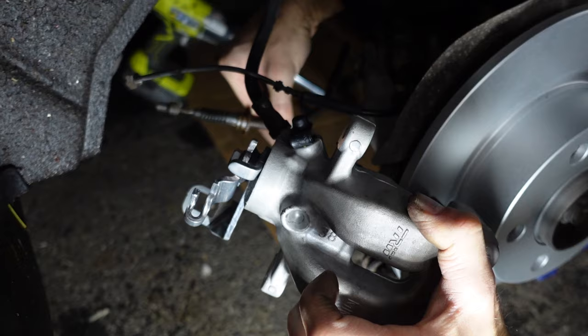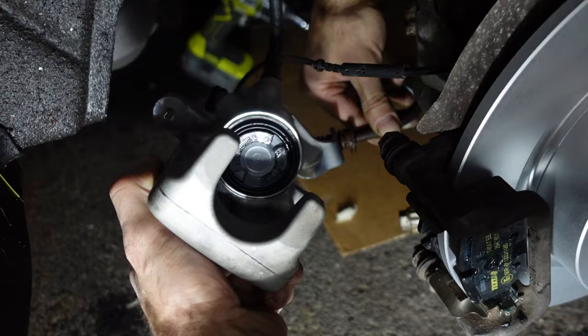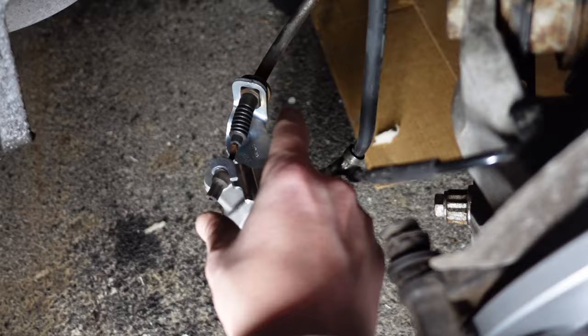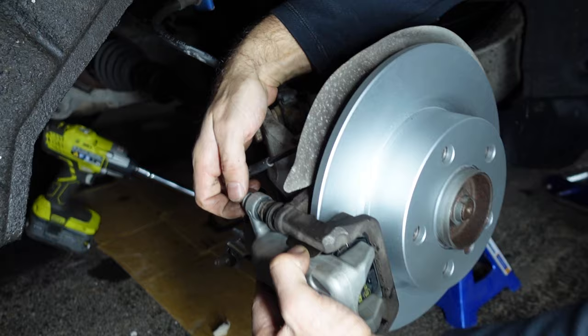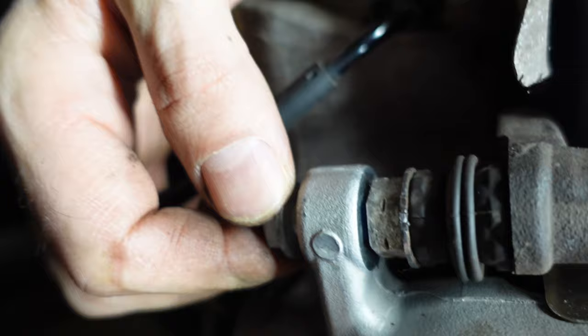With the brake pads on the right side, it's time to install the emergency brake cable. Take the cable, slide it through the hole in the back, then use a 14 millimeter wrench to open up the brake — essentially engage the e-brake — so you can put the cable in. The brake cable comes through and clamps into the catch; use the 14 mil to rotate the bolt and open it up, then slide the cable in. The caliper is ready to go with the e-brake cable in.